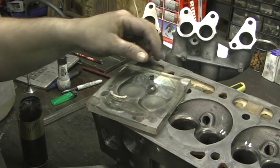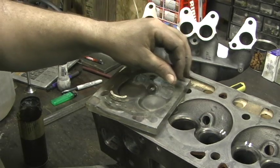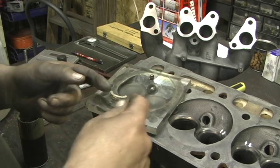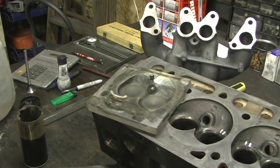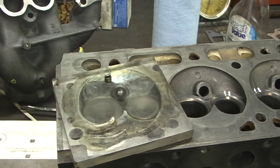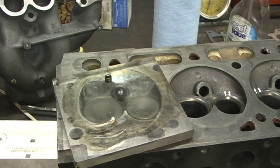We just got 53 cc's with the clayed-in area, right at 53. Remember, that's with the clay here. I will finesse it a touch more, but we haven't moved this area back yet. It's 53 with the clay. Also with the smaller valves — the 1.735 and the 1.50 — putting the bigger valves in and the valve job is going to alter that a little bit. But mainly cutting all this out, I'm going to estimate I'm probably looking at about four cc's. So if it's at 53, we're probably looking at about 57 to 58 cc's in finished form.